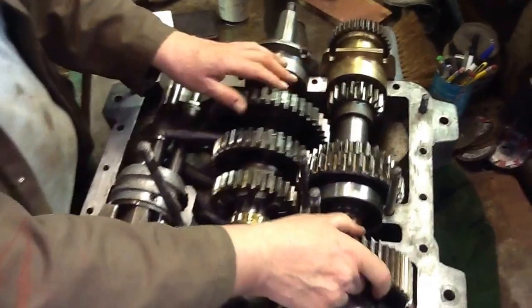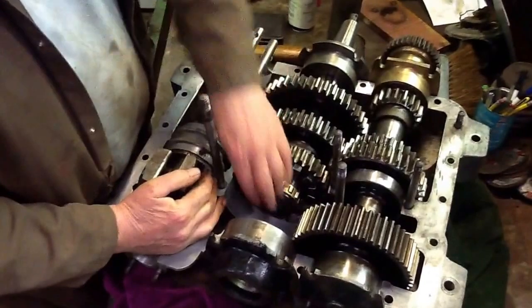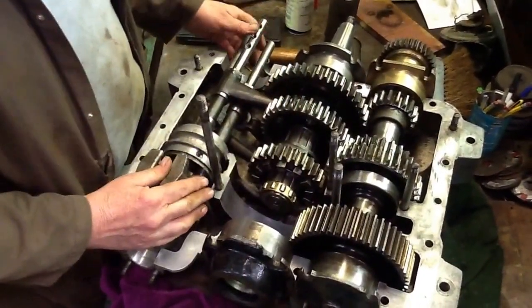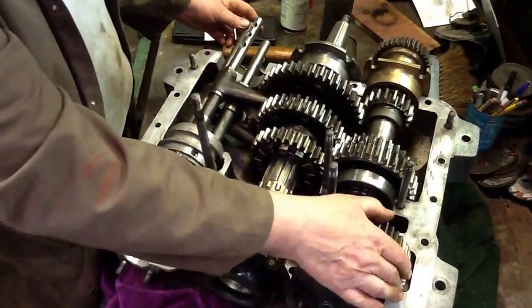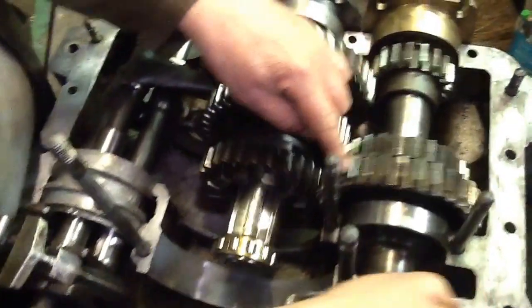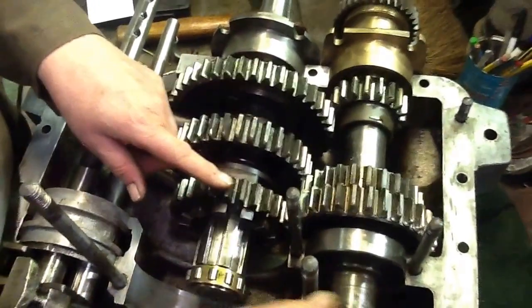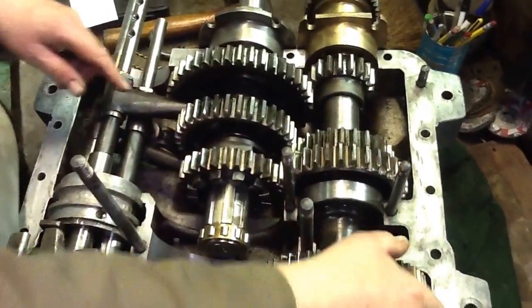You don't need as much power once the vehicle is moving, because it's got its own momentum. Having built up to speed in second gear, you then go for third. Again, you can see the driving gear is bigger again and the driven gear is smaller, so the two shafts are rotating at not very dissimilar speeds.